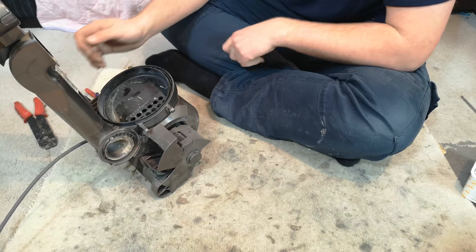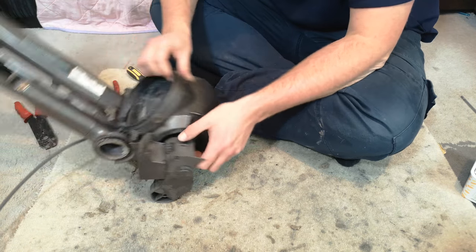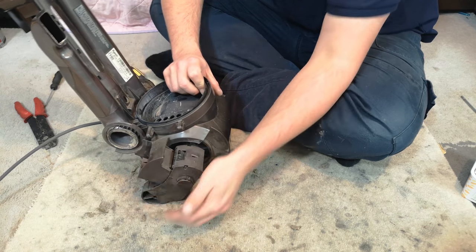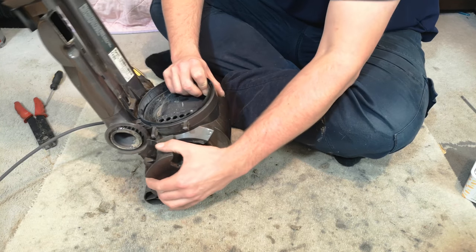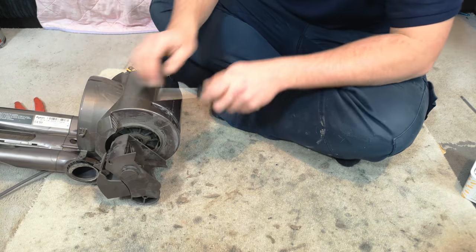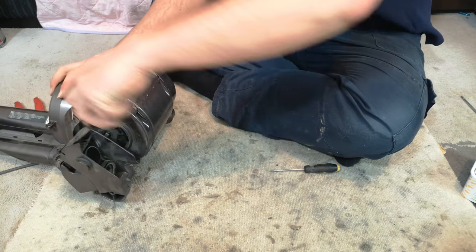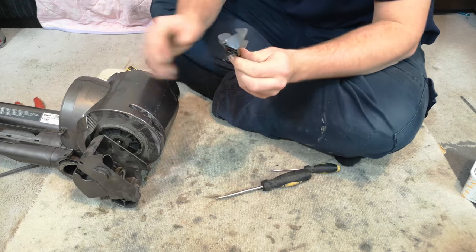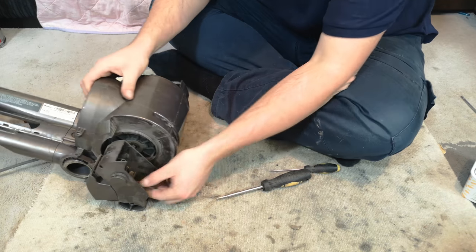It actually involves starting with this, the changeover valve mechanism. There is a button here which is what locks into place. The cleaner head pushes on this, which releases that, otherwise it would just break itself. And we actually need to take this out first, which you can do simply by getting your stout screwdriver, putting it in and just pushing down, which will release the two tabs. You want to take the spring off and that bit is gone.